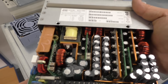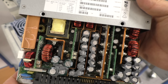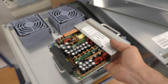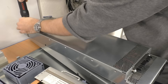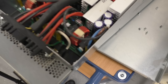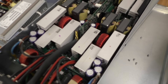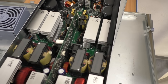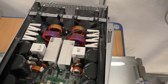Here's a quick look inside this 450-watt DC-DC converter. It has a serious amount of capacitors, all kinds of inductors, copper heat sinks, and power rails. Here is one of the main power supplies — 48 volt output, 1700 watts — and as you can see it is built fully redundant. These are in fact two power supplies in one cage.